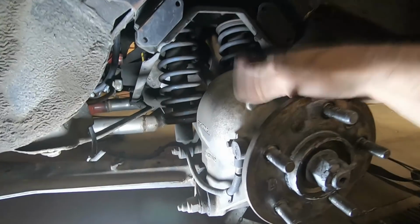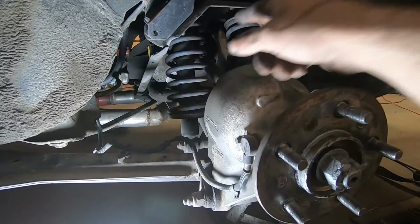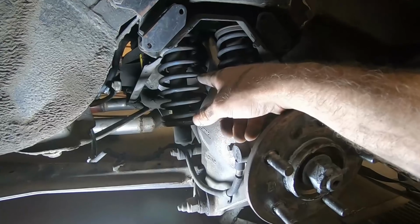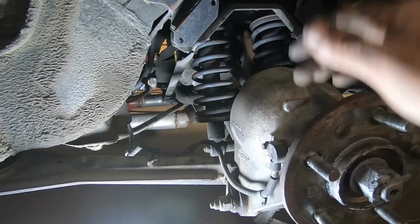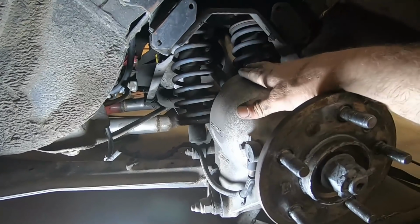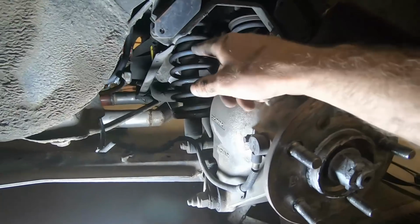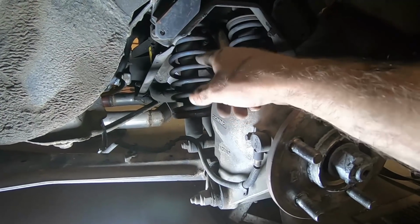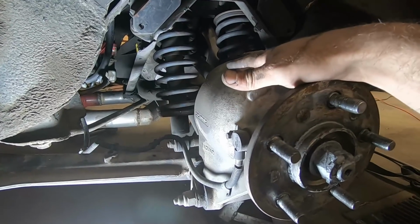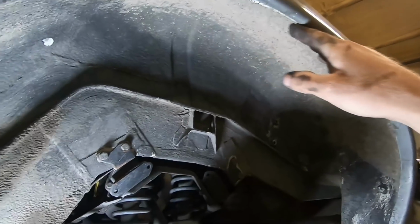Leave it to Jaguar to take something simple and overly complicate it, like moving the rear disc brakes inboard to reduce unsprung weight, which is a good thing in terms of performance, but then put it on with soft shocks and no rear sway bar. So these cars were never really full-on performance cars. They were GT cars, so they're more of a GT luxury car, really. So although they've got overly complicated, overly engineered stuff like inboard rear brakes, they're still not really set up to performance car standards.